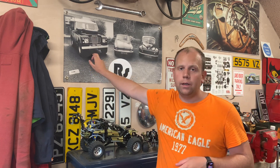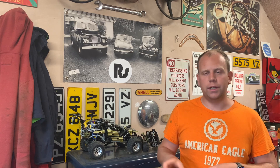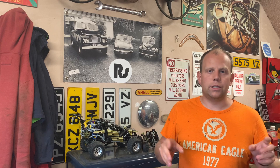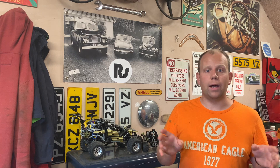The Land Rover has a two-and-a-quarter litre diesel engine — it's the original engine for the vehicle and it's never been out, other than possibly during a chassis replacement before I owned it. During the restoration there was a really hard winter, and I think the water in the engine expanded, turned to ice, and cracked the block. At the time all I noted was that a core plug had gone, but I'm fairly certain that is when the crack happened.